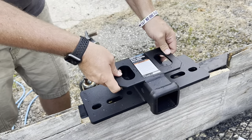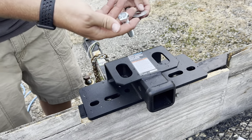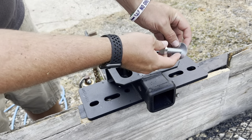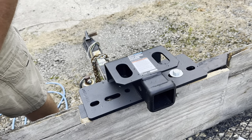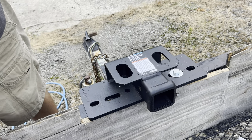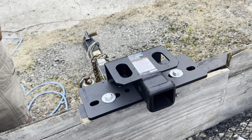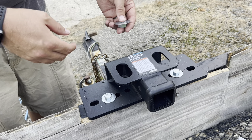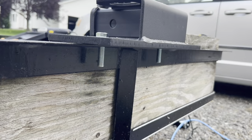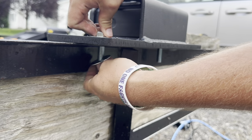I got that cleaned up. We're going to set the hitch on here, line it up, and then take half-inch bolts — two inches long — put a washer on there, feed it through the hole, same thing on the other side. Then from the underside we'll put a washer and a nut. I'm actually going to double-nut it when I'm done to make sure everything is secured.